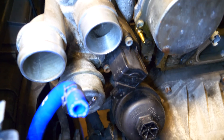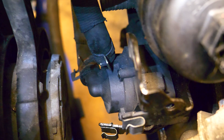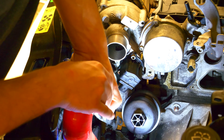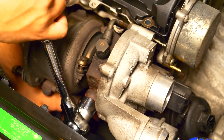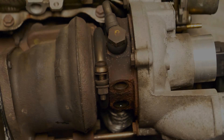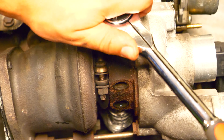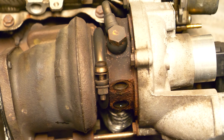With the coolant return line now removed from the turbo it's time to remove the other line — the feed line coming off of the auxiliary water pump. We need to take off the clamp found on the top of it to remove the line from the turbo. If you can manage to get this removed with just a set of needle nose pliers that's awesome, but sometimes these clamps can be a pain so if you have to resort to using hose clamp pliers, go for it. Once you have this removed we can move to the top and disconnect the 19 millimeter bolt connecting the coolant feed line to the turbo. With that removed the line can be disconnected and set aside. Now we have to move to the oil lines — there's a 17 millimeter banjo bolt that we need to remove. There are going to be two crush washers, one on top and one on the bottom. We can remove the banjo bolt now but to take out the line itself we need to disconnect the turbocharger from the exhaust manifold, which I'll get to in the next video.